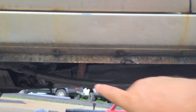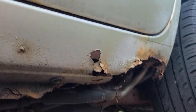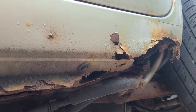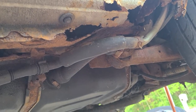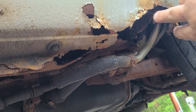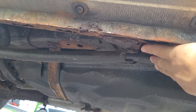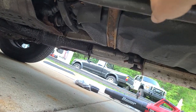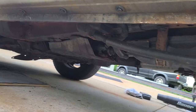I'm going to dress this up with a wire wheel. This is actually still solid, but right there by the torque box that's got to get repaired. That's going to get cut out, and I've got my hoses going back for the evap and all that so I got to be careful - I may have to unhook those. I've got to rebuild this corner right here. This will all get cut out and fixed. I actually broke this piece when I was using the needler - there's a little vent box there. I've got to take that apart and either get a new one or seal that one up.